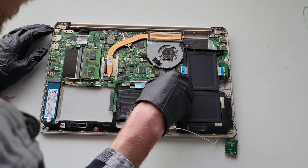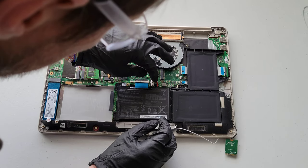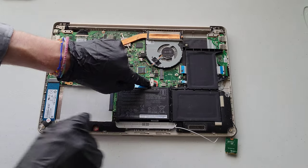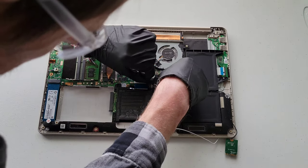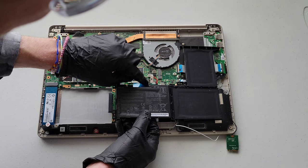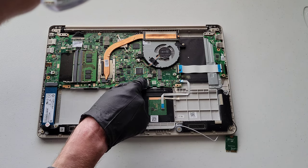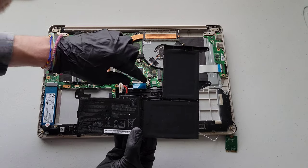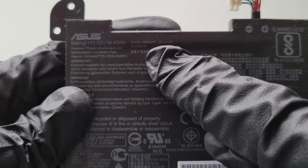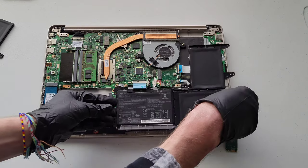There's a metal clip right here that holds the battery connection to the motherboard in place, and it seems to be bent out of place — this metal piece should clip over the top and it was not doing that. Once you have this piece disconnected, the silver piece slides back and forth. The silver piece was off, and here is the old battery — it has the same model number, B31N1637.